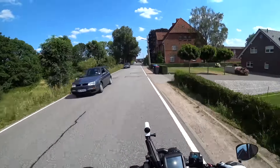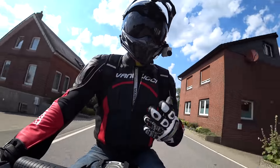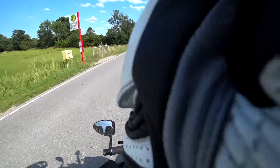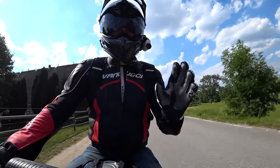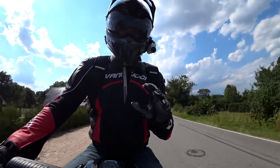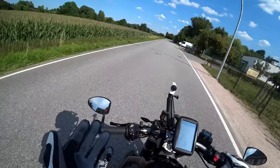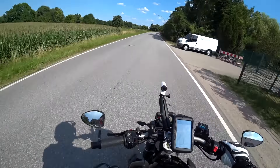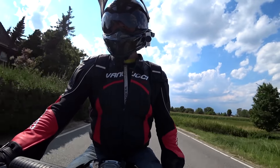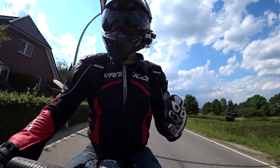Here we are out and about on the bike on the new boots. Obviously with any new tyres, the first couple hundred kilometres you need to take it relatively easy just to get the shiny surface off the top and get the release agents all scrubbed off. There's lots of talk about how maybe tyres don't have release agent on them anymore, maybe they're not so slippery, but in any case you should always just take it easy for the first couple hundred kilometres.